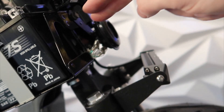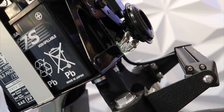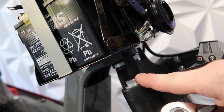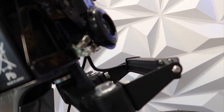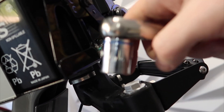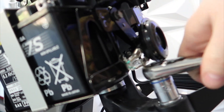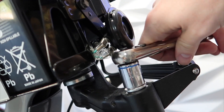That's going to be a super clean front end setup. The next part, like I was saying, I'm going to show you how to lower the front of your Ruckus. Typically, if you can take the battery box cover off right here it'll make things ten times easier. Mine I just slid off because I'm still working on the bike. These are 17mm sockets on the top. What I like to do is turn the handlebars so you have some clearance to pull the spring up. I've already pre-loosened this a little bit, so I'll go ahead and finish loosening this.